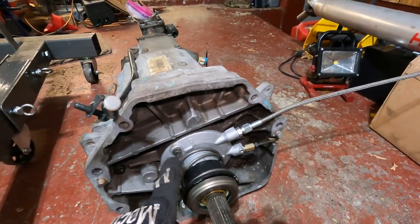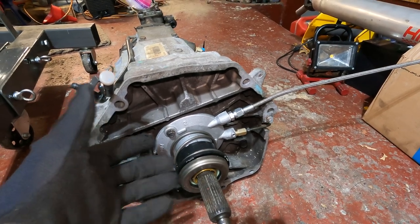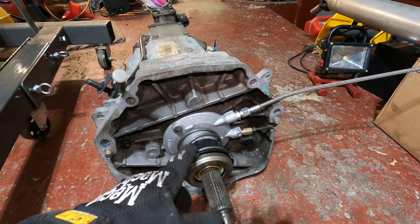Also on my clutch I've got a little burn spot - a hot spot on the flywheel - and it doesn't feel like there's any deviation in it. Is that an issue? Let me know because I've never really had that on a flywheel before. And on the transmission slave cylinder - the GM stock one was about $200 and my last one crapped out. Are there any upgraded options? I really want to beef this up. I want to upgrade the transmission too eventually but that's a couple thousand dollars and I still want to do bigger rear brakes down the road. Thanks for watching - like, subscribe, and I'll see you in the next one.